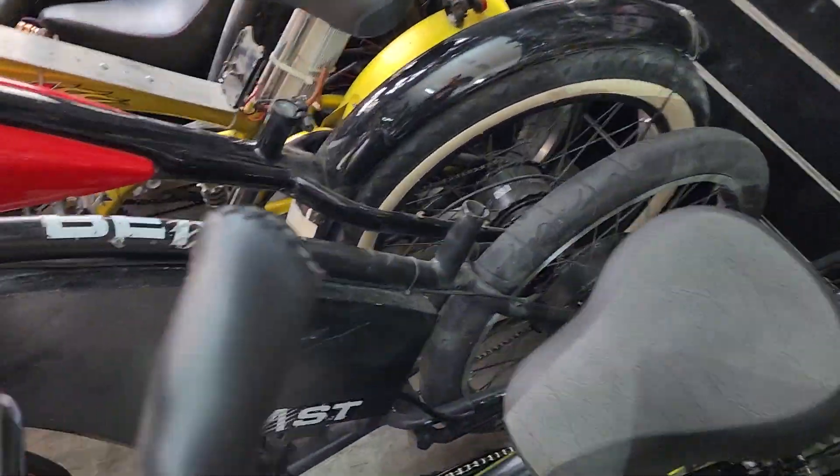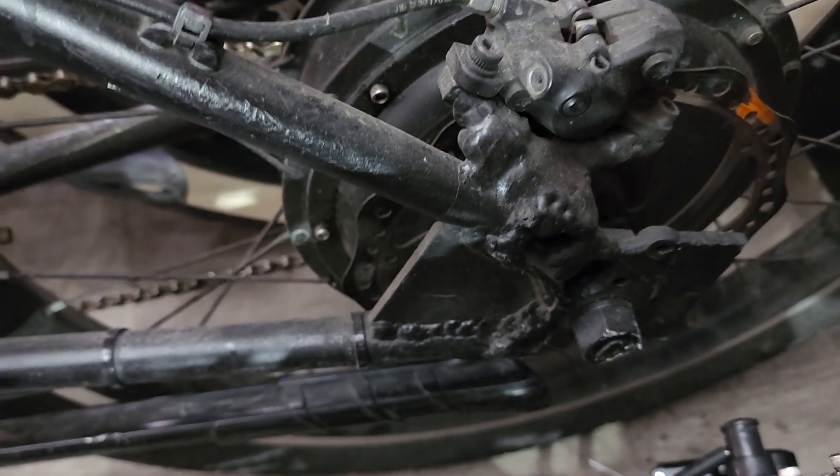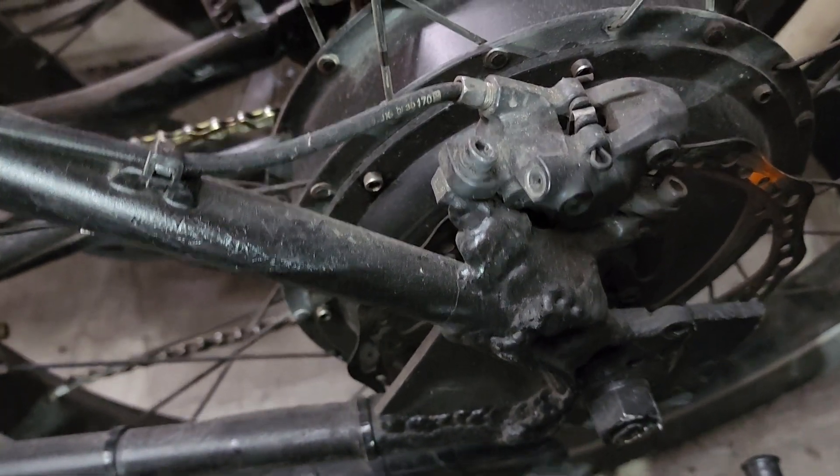I got this one that's built, just waiting for a new battery. It's almost like a townie-type frame. I built a box for it, put a 3,000 watt motor in, did all the strengthening in the back — welding of the aluminum, welded for disc brakes on there. It's not the prettiest but it does its job.